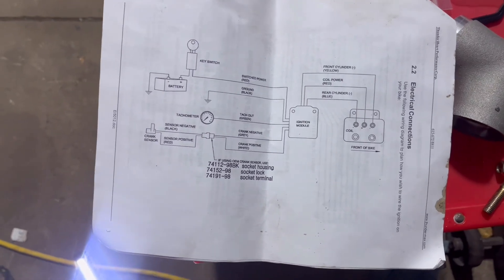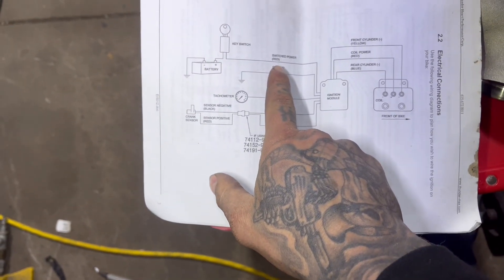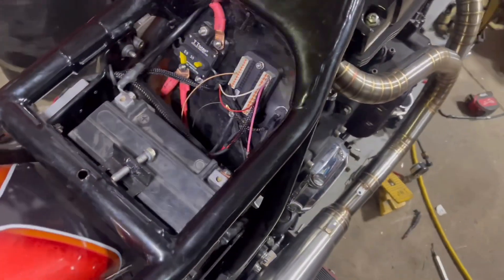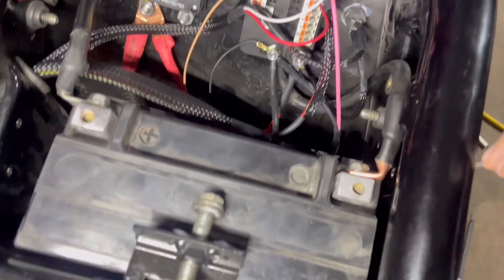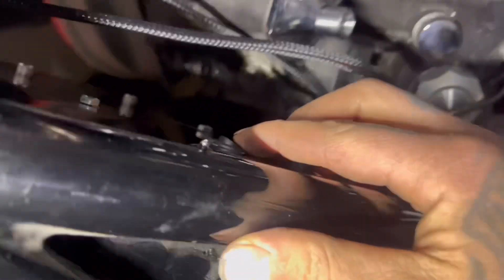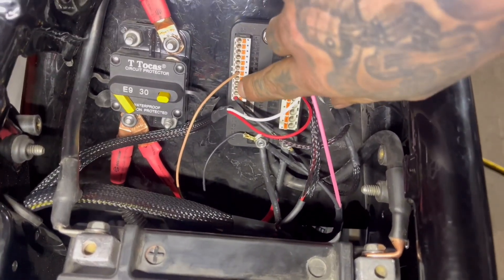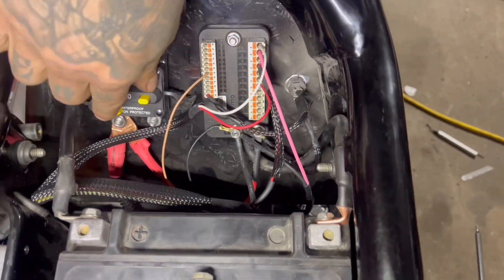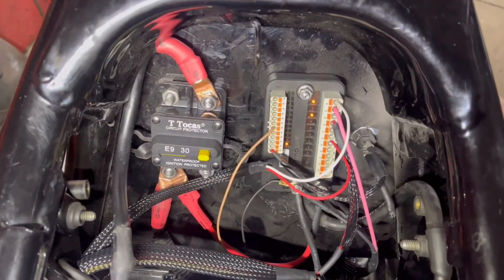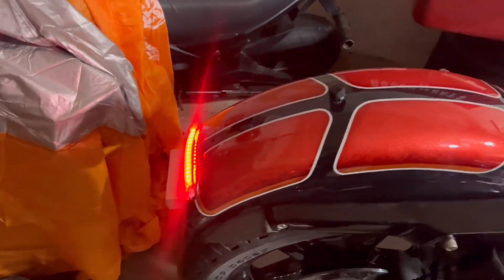It's a seven-wire hookup. The only difference between this diagram and what I actually had to do is I had to cut the switch power coming off the red wire that goes into the ignition module and tee that into the M unit. You cut that red wire and put it into lock. This is my switch power — when I hit the breaker, power comes on, the wire goes into the lock system, which unlocks the M unit and gives power to the bike. Hit the breaker, hit the switch, it cycles through and gives power to everything — lights come on, tail light comes on.